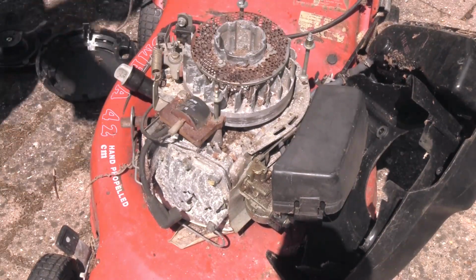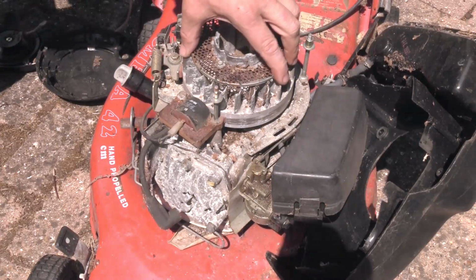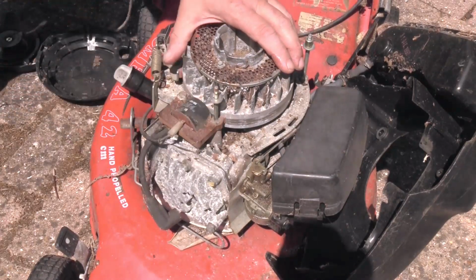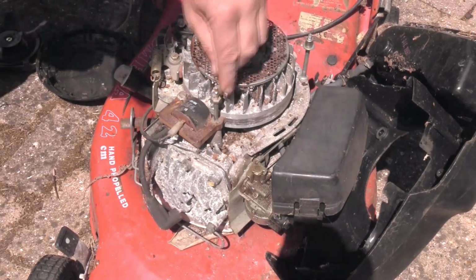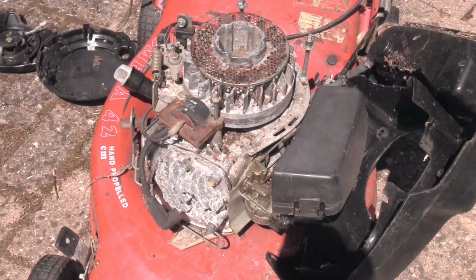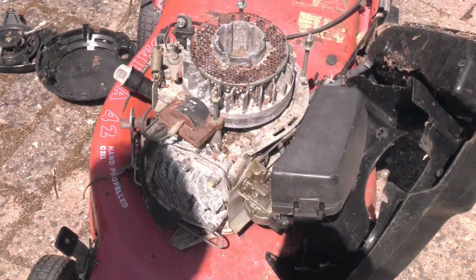So I think what I'll do is I'll tie the clutch back, so it's not interfering with the flywheel, and we'll have a look. This side of the coil looks like it's actually touching the flywheel, so that's no good. We're going to move that away. And you see one bolt on it, which is a bit... Oh, maybe that's it. Just a little bit there. So, yeah, let's reposition the coil. So we'll do that next, and pull the crankshaft brake off,